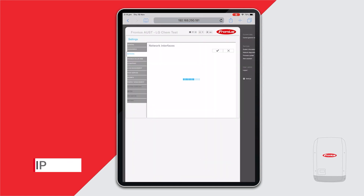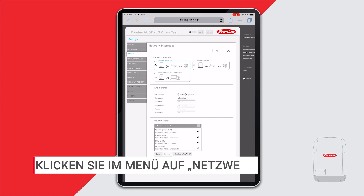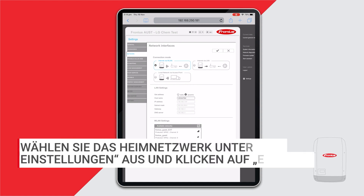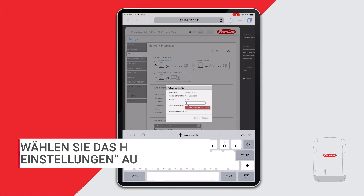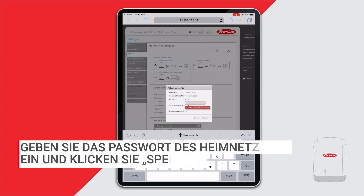On the left-hand side of the page you'll see various tabs. Go to the network tab and then go down to WLAN settings, and find the Wi-Fi network that you need to configure. Click on that and press set — this is where you put in your password.